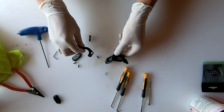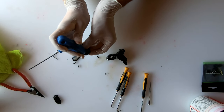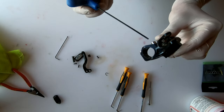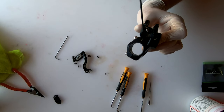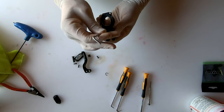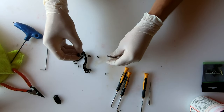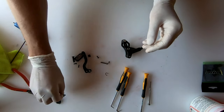Your lever is going to come off and this little brass barrel sits loose in here, so I'll push it out to show you — make sure you don't lose that. In the reservoir there's a little seal or cap that holds the plunger in place; it unscrews with a T10 Torx. Once unscrewed, you can lightly pull on the plunger and it'll come out.